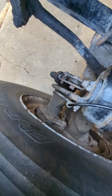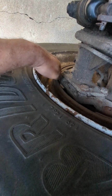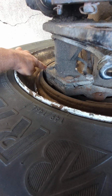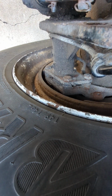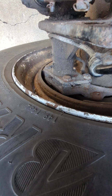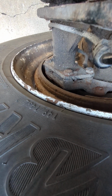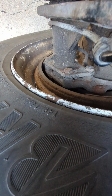Right? So you can keep the camera right there, and I'm going to reach down, and here is my brake drum all the way around, and then my brake pad, and there's another pad over here, and they're properly mounted, secured, not cracked, bent, or broken. And also there's no debris on the pad, there's no grease, there's no oil on the pad, indicating some sort of leak somewhere else leaking onto the pad, and it's dangerous.